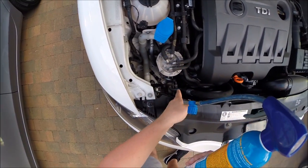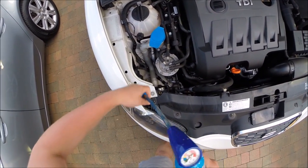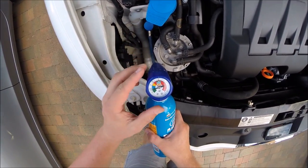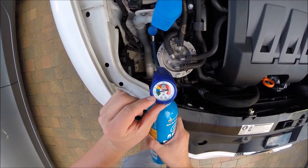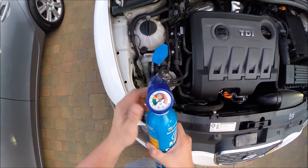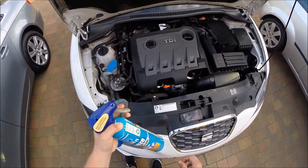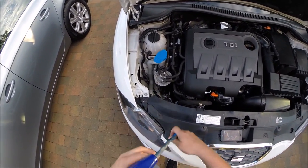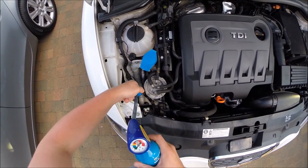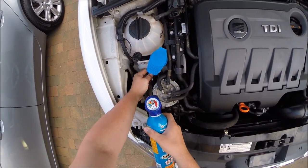This will only fit on the low pressure port — the high pressure port won't fit, it's not the right size. Keep that safe. Attach your valve to the low pressure gauge. You can see they're rocking out at about 15 PSI. We need to go ahead and shake this bottle, give it a shake, to re-gas the air conditioning system. Put this back on and turn it to between 12 o'clock and 3 o'clock, just to get some in until we get the right amount.